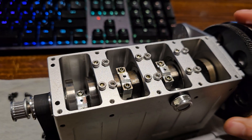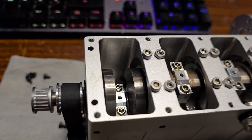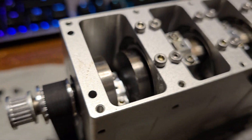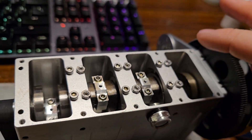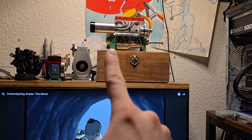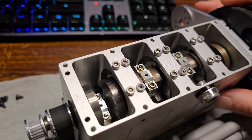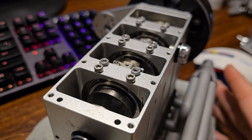But this one is loaded. Looking down in there — yeah, that's just a main seal — so it looks like they don't have bearings on the ends here, whereas that other one does. It has a ball bearing here, ball bearing here, and a center support bearing.